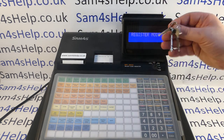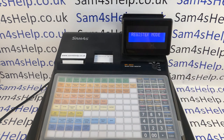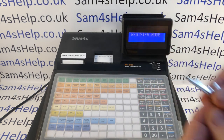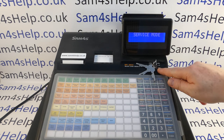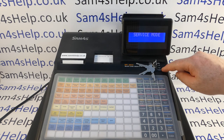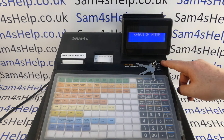First thing you'll need is the sequence of keys that came with the machine. The key you need to carry out the factory reset and memory allocation should be marked with the letter C — that's the service key. You need to turn it round, pop it into the key lock, and turn it round to the service mode. When you put the other keys in they don't all go to all positions — that's to protect you, so the reg key will only go to reg mode for sales only, stopping staff doing reports, programming, and voids.